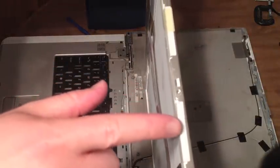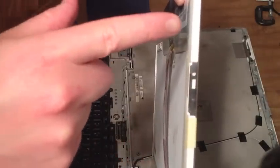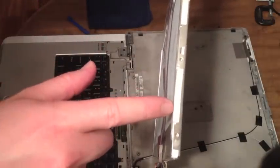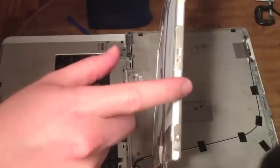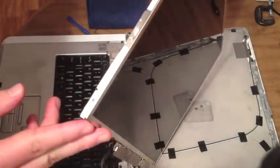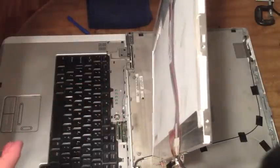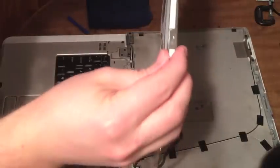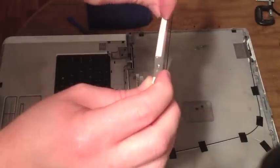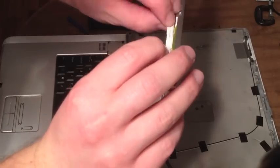So the only thing I can see is, if you look at these pieces of tape along the side here — this one, see how the tape goes almost all the way to the front edge of the screen? This one's a little bit less. This one's a lot less — maybe it's loose. So I'm thinking maybe pull that tape up, tighten it as much as I can, maybe even put another piece of tape on there. Then probably what I'll do before I put this all back together is just plug in the screen, put the battery in, power it on, see if it worked, and then if it did, I'll put it all back together. Let's see if we can loosen this piece of tape and tighten it up. That would be an easy fix if that's all it is.